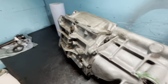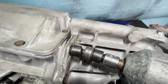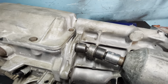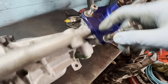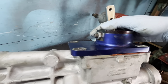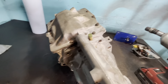Now we're going to blast off these 15 millimeter case bolts. Get yourself a set of Matco swivel sockets - I've had these for years, abused them, and they're still like new. Drive that roll pin all the way down, and once you've got the roll pin driven in and all the case bolts out, you're ready for the next step.